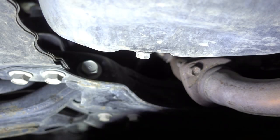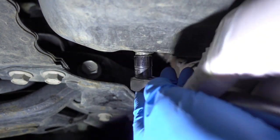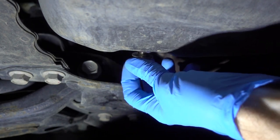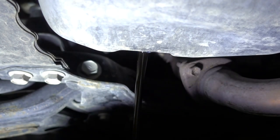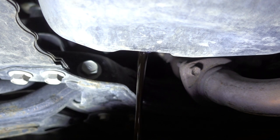You're going to see two oil pans — you want the one on the passenger side. I'm trying to grab that crush washer; looks like it's stuck to the pan, I'll get it later. Position your pan so you don't miss it. I'll let it run out till it stops dripping. The good thing about jacking the car up from the front: the plug is on the rear end of the pan, so that facilitates draining more oil out of the pan.